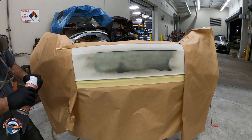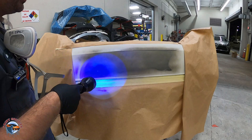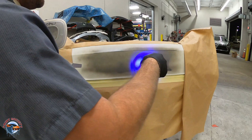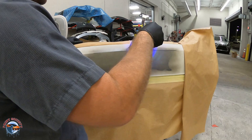Let's do another coat right now. This is your second coat. You kind of have to get away from the fact that it is transparent — that does not mean it is not building. You will see when I go to sand this that it is actually covering very, very well. There's no difference between a rattle can and the regular gun — maybe a slight difference, might cover just a touch better, but for small stuff the rattle can interacts the same way. There's no hardener, there's no difference.